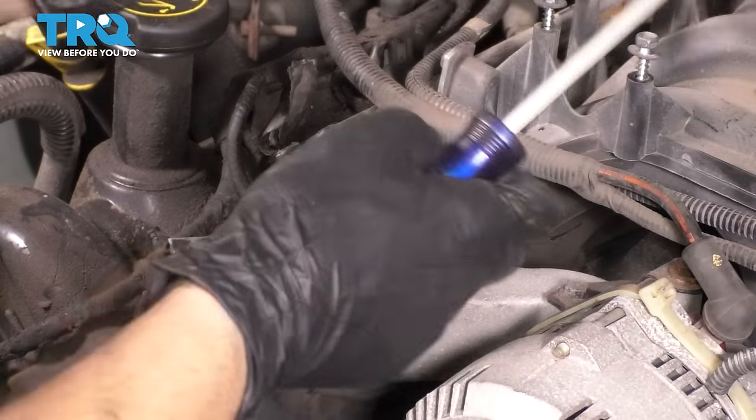It's my only option. Oh, and on the head bolt, I put this wire tie here so that it doesn't drop down into the head past this, and it won't hit the accumulator, but it also won't make contact with the block so that the head can actually slide on there. You'll see what I mean. Well, I mean, you did the job, so you already know. Just as a reminder, that head bolt goes in the second to last bottom hole there.